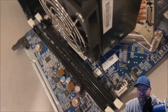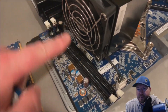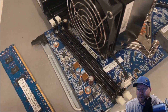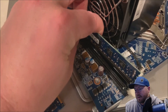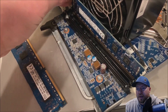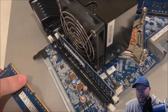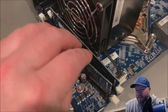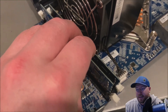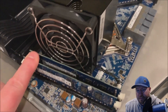We're going to put the last two modules in. So we have 24GB already installed, so this is going to get us to 40GB — which is kind of a weird amount of memory but you know, 40GB is 40GB. Line up the notch and go ahead and click them in left to right. If you push it down in the middle it most likely won't click in evenly, so copy exactly how we install these modules — it's simple.